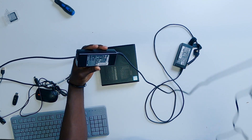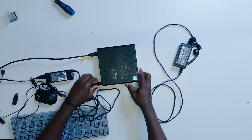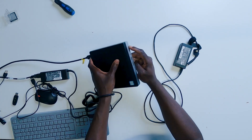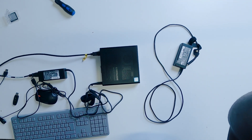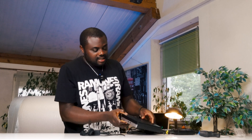I finally got a 90 watts power supply — it's marked here 90 watts. If I connect this 90 watts power supply to this PC and hit the power button, it's going to quietly boot up. Look at it — the white light is stable. And if you take a look at the monitor right here, it's booting up onto the monitor screen. This is exactly the problem.